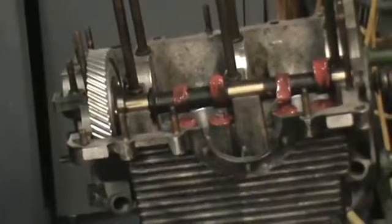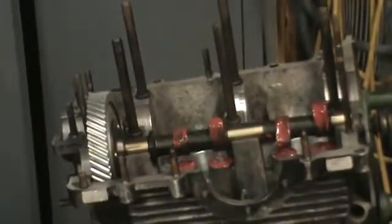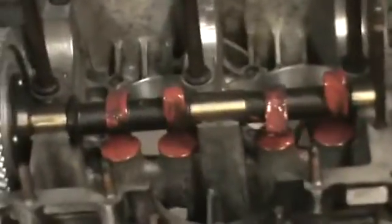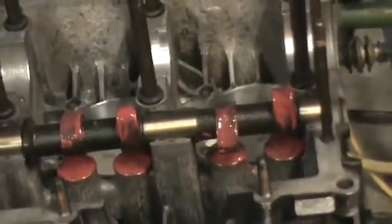Here's the case. We've got our lube on our cam, our bearings installed in there, our cam bearings in there, and our lifter. We've got a cam plug set off to the side over here, some main stud washers, and our main stud seals installed. You see there. We're getting ready for our final assembly here on the 1915.